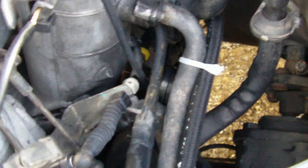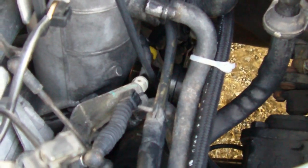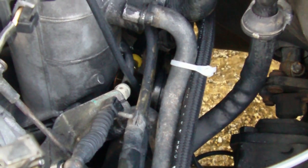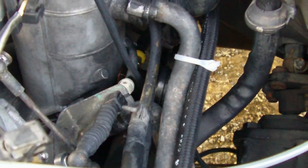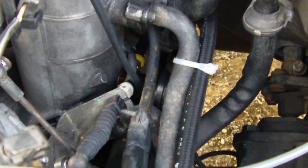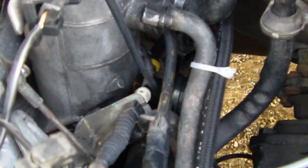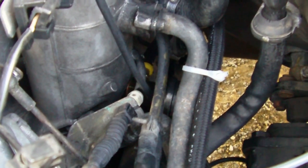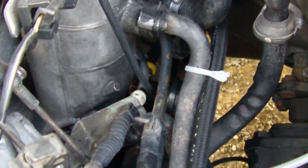I had a little trouble with it trying to get it positioned in the right spot so I could get the line connected. I had to make a special gasket for it — the one that came with it wasn't thick enough, and if I added a second copper washer, it was too much. I ended up cutting one out of paper, or really light cardboard like food packaging, and that was about the right thickness to get it positioned where I could connect the line to it.